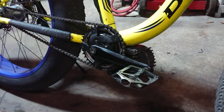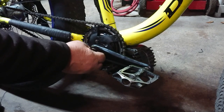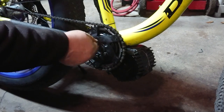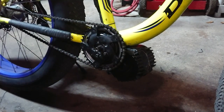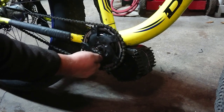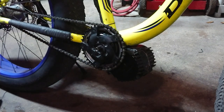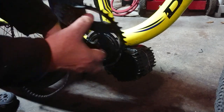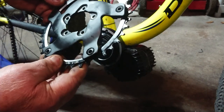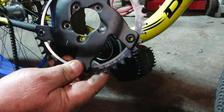Here's what we've got — about two 38-tooth chainrings from Amazon for the BBS HD. I've already loosened everything up so I can check the metal, and it's grinding directly onto the BBS HD housing. I think it needs a one millimeter offset. A 38-tooth chainring is the smallest that will fit on a stock BCD 130 spider, as you can see here.